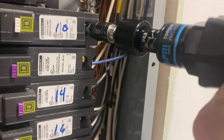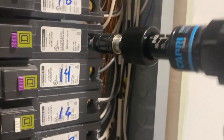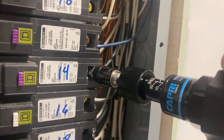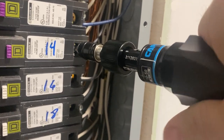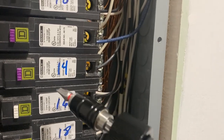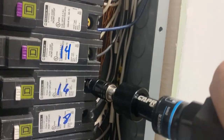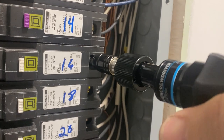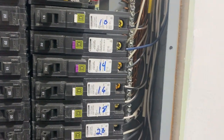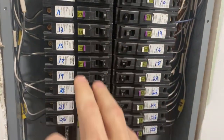Starting at the top — I didn't get any extra turn on that one before the torque wrench slipped. Here's the one I changed out with the microwave; I tightened it by hand and got no extra turn on that either. Next one down — I'm getting a slight turn, maybe a quarter turn, another quarter turn, and now it broke free. That one was significantly loose, not to spec. Next one down — getting a little bit and now it broke free as well. So that's two out of four that needed more tightening.